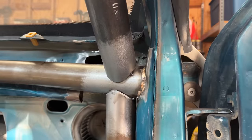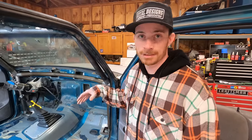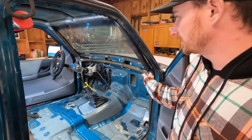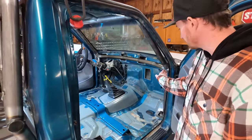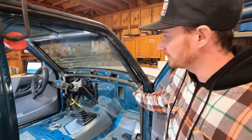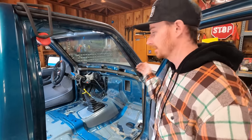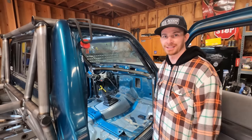That's something you don't see too often — silicon bronzed directly to the cab. The only downside to doing it this way is you're not able to drop the cage. I've seen it where the tube runs across the truck and it's just open-ended — that is not cool to me. I spent the time to get this to fit very nicely to the cab on both sides. It might make it a little difficult if the truck gets rolled and stuff gets smashed, but at that point there's so much more to deal with anyway.